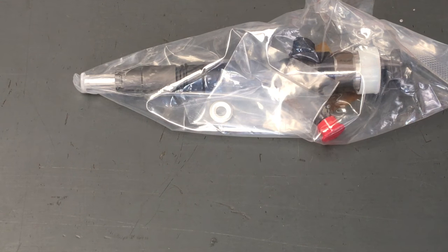Now, with the later ones, so 09 onwards, this video was going to be another quick 3 or 4 minute one, but the info just keeps spilling out, doesn't it? With the later ones, September 09, where the injectors change, so right on a 120 and a 150 Prado is where they changed. Same vintage in Hiluxes, but they didn't change shape, so it's still the same Hilux. But September 09, roughly, 150 Prado onwards, you need to also do the pilot learn.